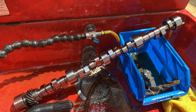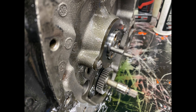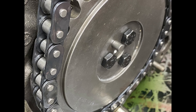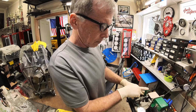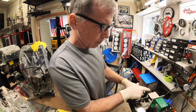It's a billet core — I always like seeing a billet core. It's quite a big camshaft; you saw the cam card earlier. Now the cam pin many times is too long, not too short. I eyeballed it and it looked a bit too long, so I pulled it and put the cam in, then shortened it and pushed the cam back in. If the cam pin is too long, it'll bump and push forward against the cam sensor.